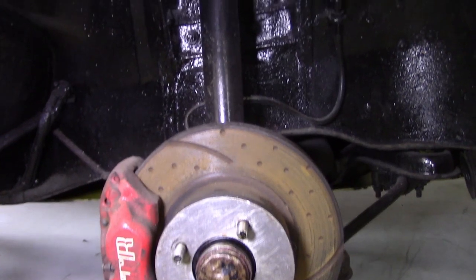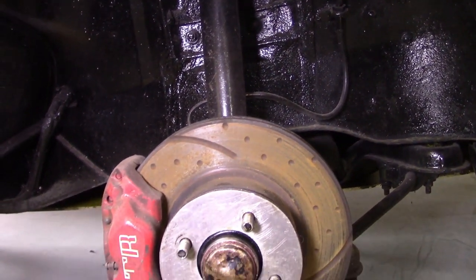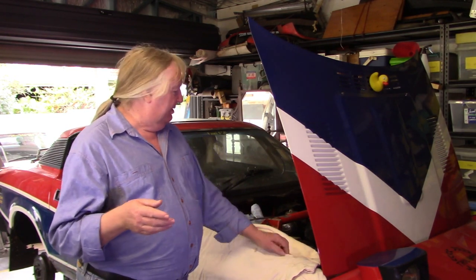I'm chasing a steering shake — not the traditional TR7 80km/h steering shake, which I've lived with as it's only minor. This is a 'put your foot on the brake and the whole car shakes itself to bits' problem. I don't know where it's come from and that's one of the reasons the 7 went off the road. I spent 18 months chasing that problem getting absolutely nowhere — there is basically not a single component in the front suspension and steering that hasn't been replaced. The camber adjuster might help; some expert theorised about the caster particularly. I don't know, but I'm going to give it a go.